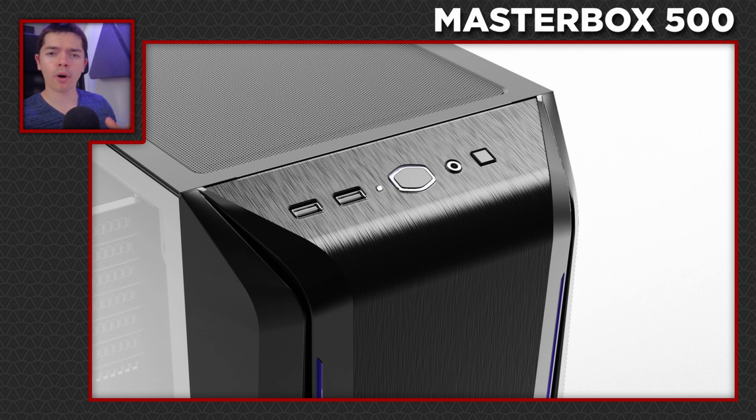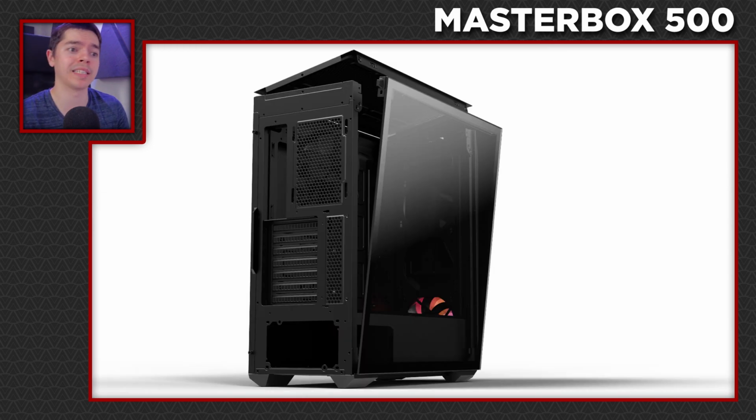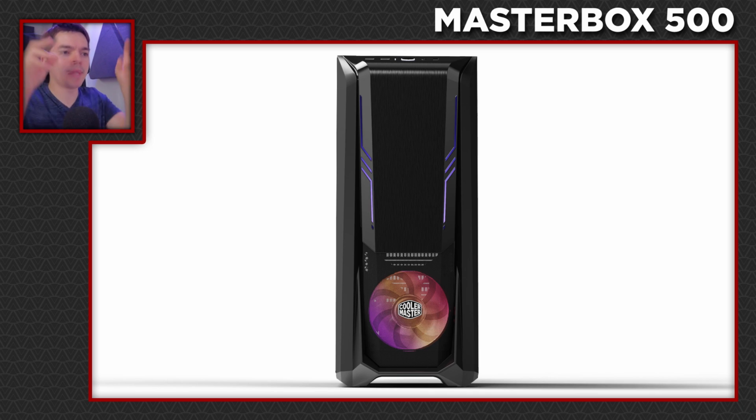So anyway, to the bottom, there's a small opening. That's a small mesh panel opening, which really has the intake area for maybe at max a couple of 120mm fans, but realistically it's kind of the area for one 140. There is room in there for up to 3 120mm fans to the front, and you can even stick a 360mm radiator behind there. But in terms of the actual intake area, I'd like to see if there's side openings or something that they're increasing that with. Might be a pretty poor performer.